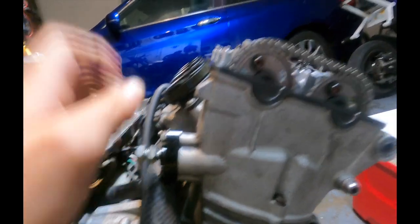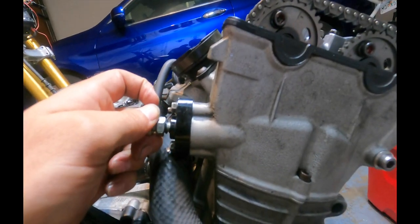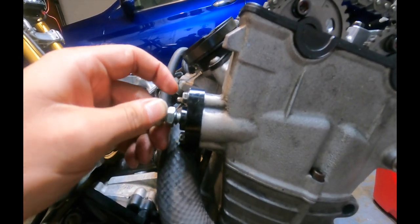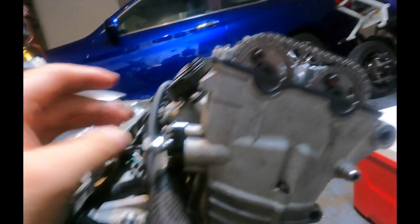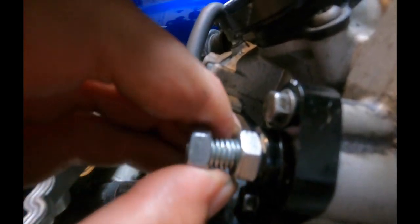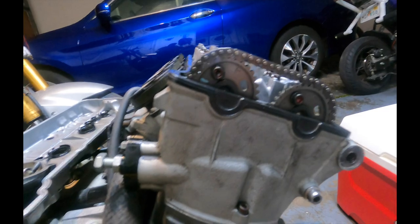Now we're tighter. If I tighten it too much it's very tight, so what I like to do when it's on the bike: I start to turn the tensioner in, and as soon as I feel that pressure I go about a half turn and then back off about an eighth. That should be it — perfect tension. Once that's set, turn the second bolt in, hold the nut with one wrench and tighten the nut to the right with the other — and that's it, your cam chain tension is set.